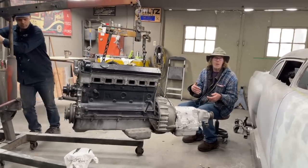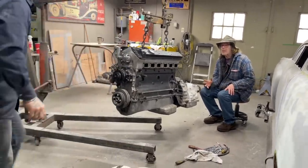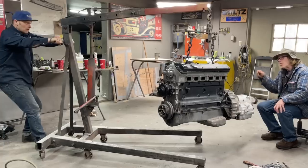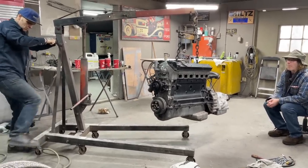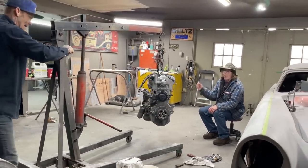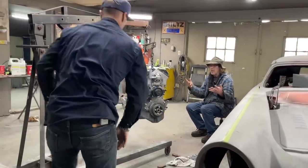The same as if you put silicone on a gasket, like a cork gasket, it just pushes it out. You can put silicone on a gasket, it's not that bad of an idea, but make sure you never tighten the bolts till the silicone dries, and then slowly over a couple days snug up the bolts. But if you just put on a valve cover that has a cork gasket and you just tighten all the bolts at 20 pounds foot torque, you're just going to mushroom and wreck that gasket, and it's going to leak and it looks like hell.